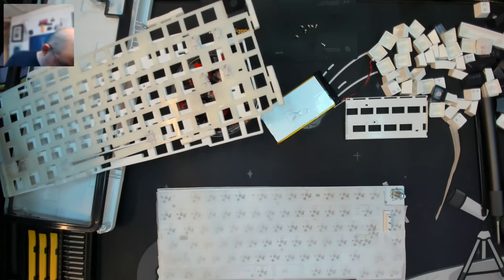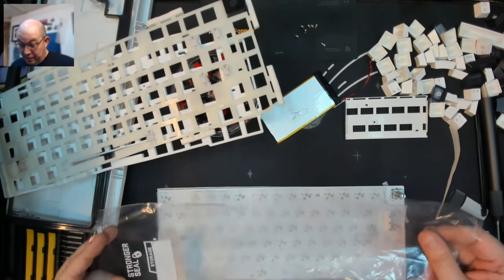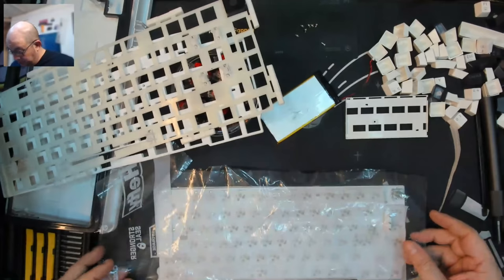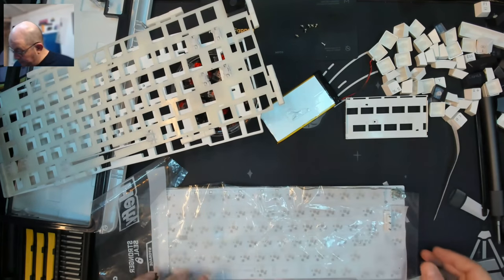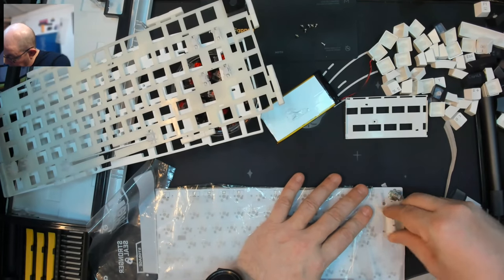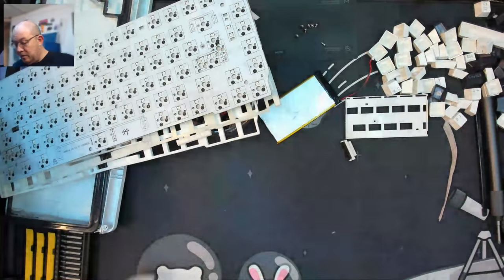Now the next thing we're gonna do, we can use PET plastic, which I have some sheets of, but I have been testing and I have found that the Ziploc Hefty bags do just as good of a job, and you don't have to pre-cut the holes, which means you don't have to worry about punching out the holes for the center studs and the extra pins on a 5-pin. So what I'm gonna do is go ahead, I should probably take this out as we're gonna need to put this back down in a minute, and I can just use this as a stencil.